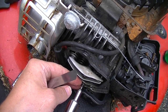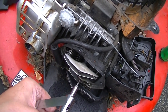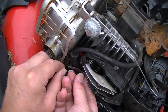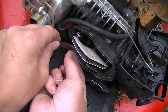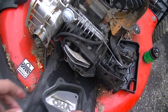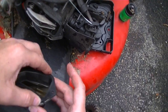And then we'll tighten that set screw back up. Like I said, not overly tightened. All right. And then we will double check. And it's hard to push in there, but that seems about a 0.003, so I think that is correct. So now we'll get the cover back on. Get the valve cover back on here. We'll make sure that all our gasket's clear of debris.